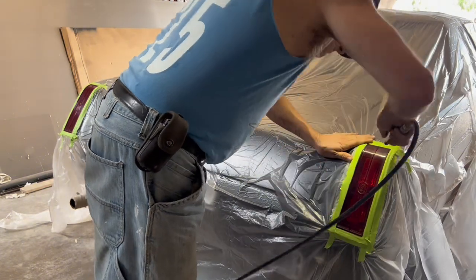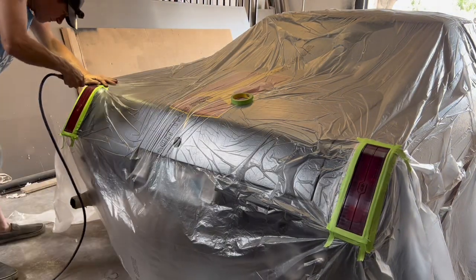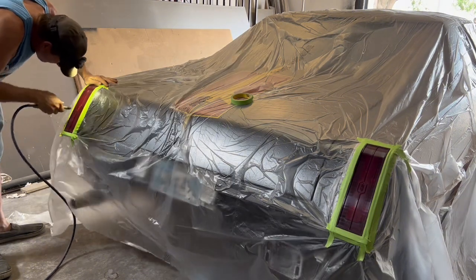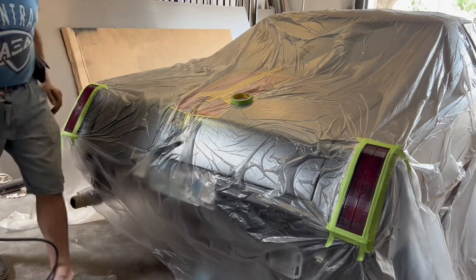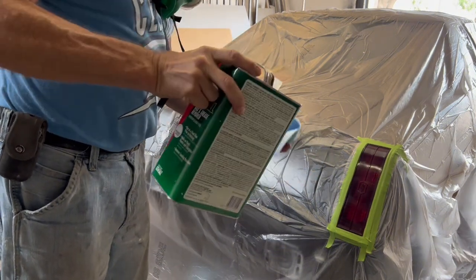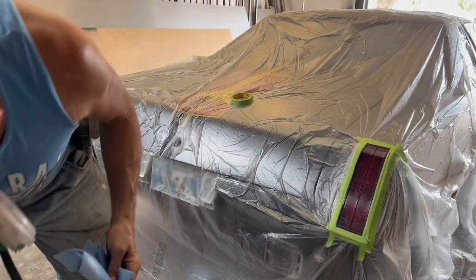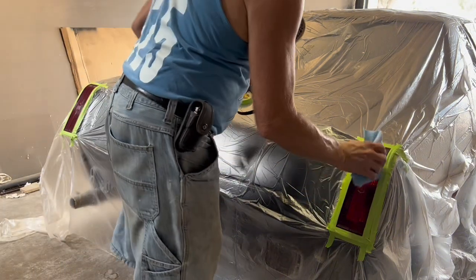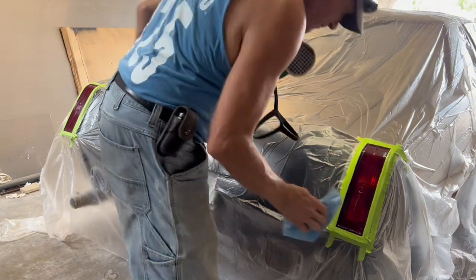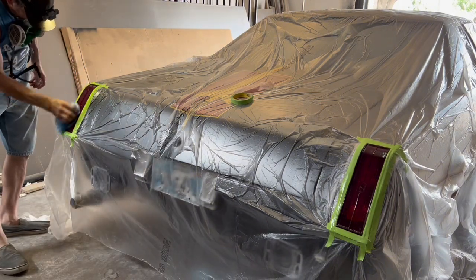I'm blowing out the cracks and stuff around the taillight to make sure dust down the cracks won't come out. Then the next step is to take my grease and wax remover and pour some on a paper towel and give them a good wipe. The 59-54 super duty compound is paint friendly and whatever residue's left will get wiped off now — but even if a minute particle remained, it won't cause fisheye because it's paint-shop friendly.